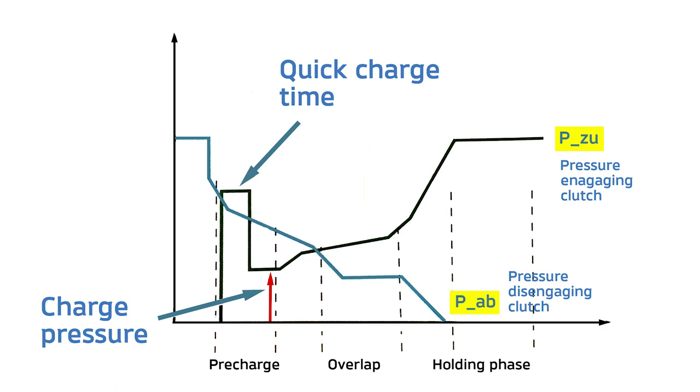The target is for brake D to meet brake C at the same speed, or overlap. During the test drive relearn, it is a hit and miss situation at first. That is why it's necessary to try five, six, eight, or even nine times during the procedure. After multiple attempts, it gets pretty close to that sweet spot. And as the customer continues to drive the vehicle, the more personalized that spot becomes.